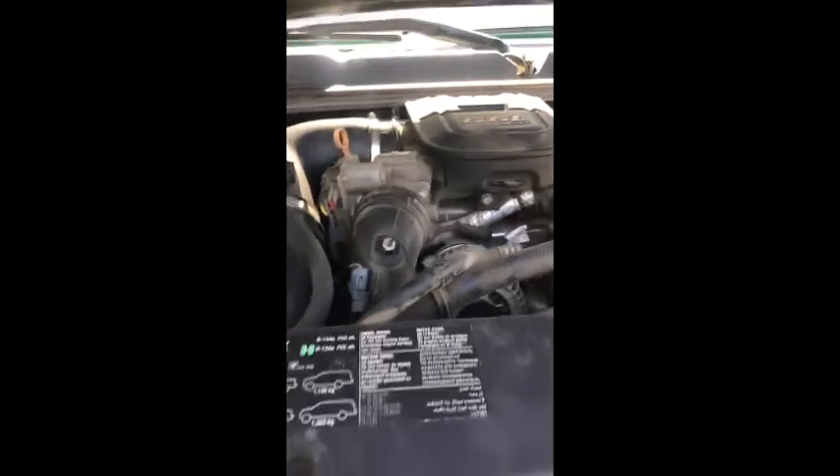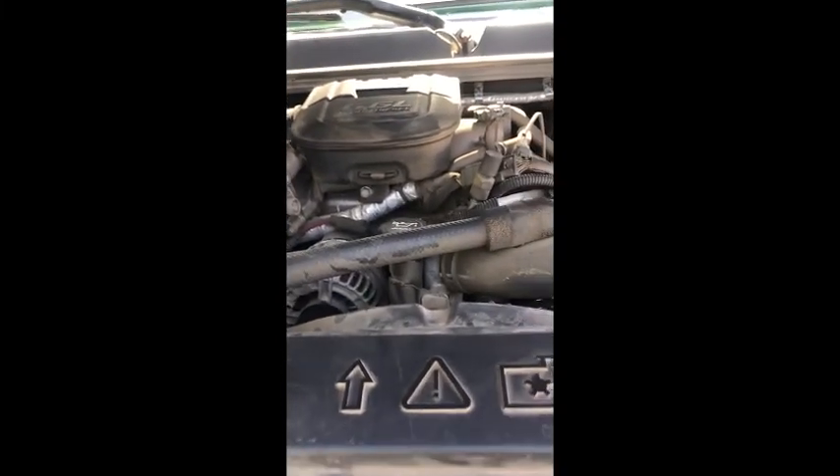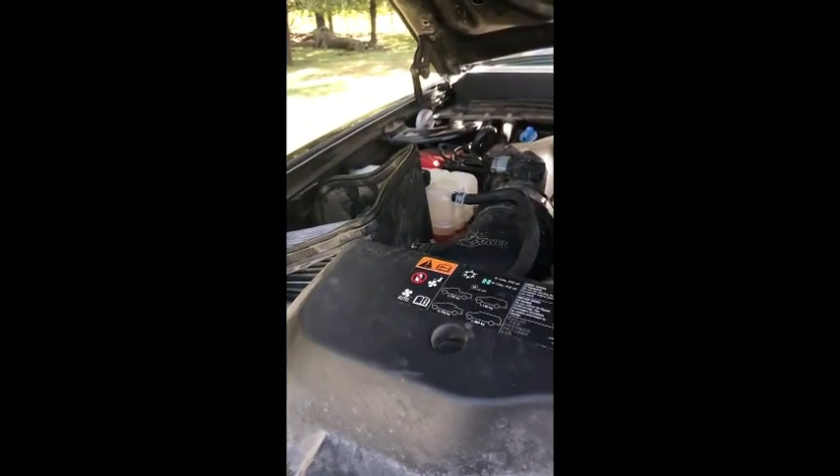You can never see this happen because it only does it when you're pulling, but we're getting compression into the water coolant system, and it starts pushing water out the overflow. So I'm presuming it has a cracked head or head gasket — it has to be something coming from the compression system into the water jacket cooling system.